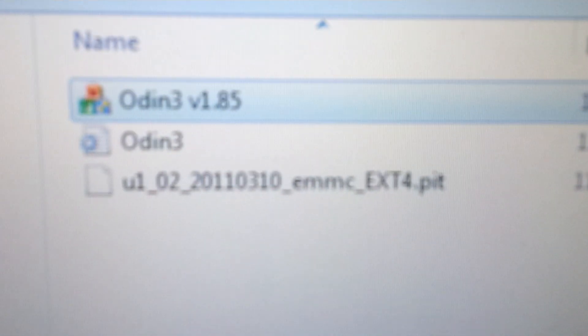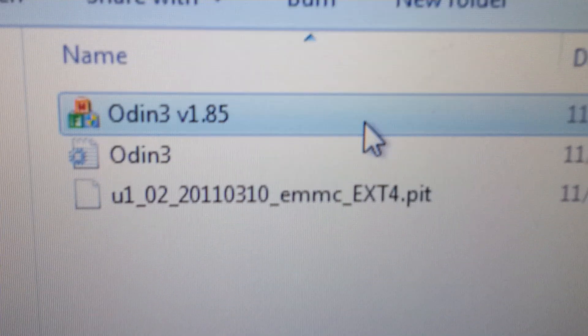Right here is the direct link — it's 800 megabytes. You need to have the USB driver for the phone running on your computer. You need to have that. Once you get everything set up, go to your Note, make sure it's not connected, then press power and volume down.